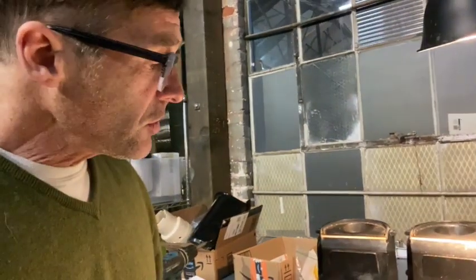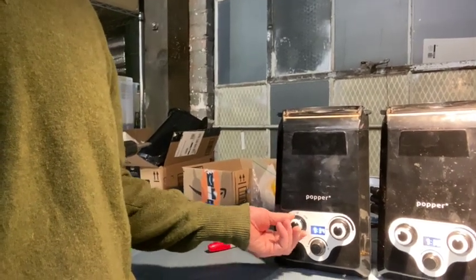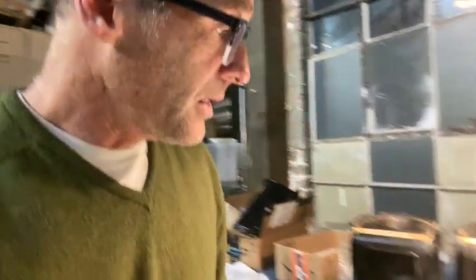We are replacing these units, but what you should do is: if you hear an inconsistent motor speed like that — variable sound, lugging and labored at slower speed — you should stop using it right away. Because what will happen is it's not turning your coffee, your coffee is going to burn, and that burned coffee is going to create a lot of smoke and be nasty.